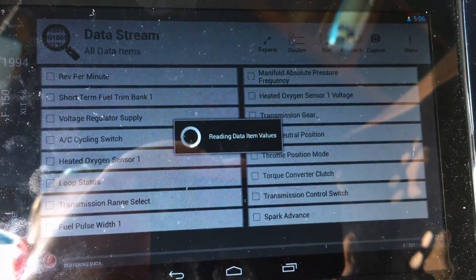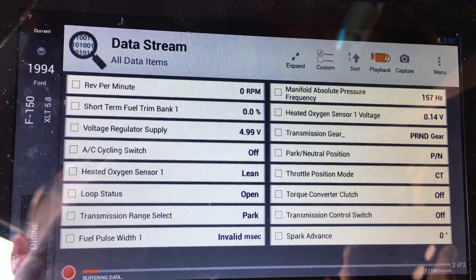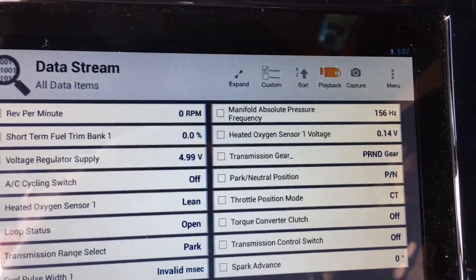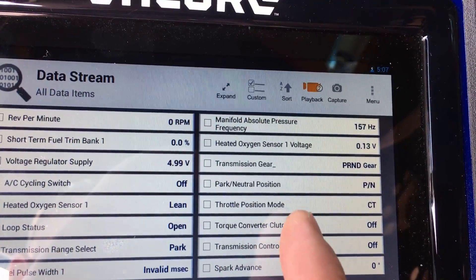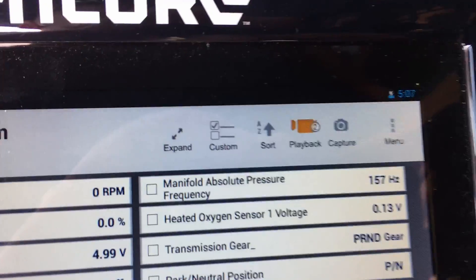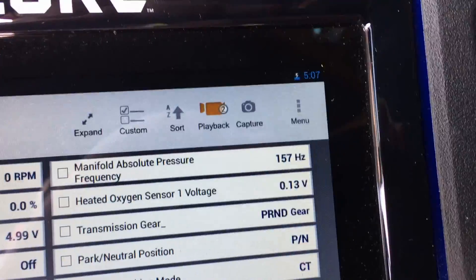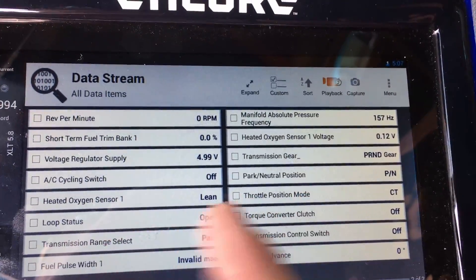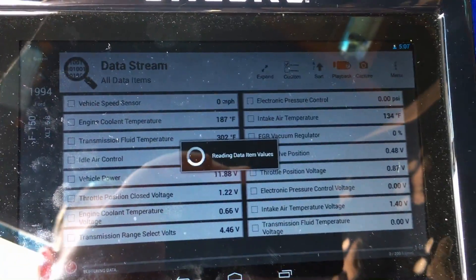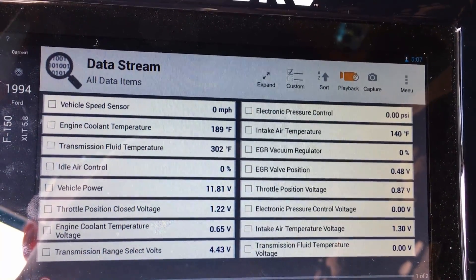Let's see if we can get another page of data and see if it comes up live. The engine is key-on engine-off right now. You can see the voltage, regular supply — awesome information in there. Torque converter information and clutch info are in there too. MAP frequency is interesting — that's good information to let you know if it's correct for our area. So we have two full pages of live data we can go over when diagnosing a concern. That's going to be invaluable to see what the PCM is actually seeing. Let's go ahead and try it on the OTC 3211.